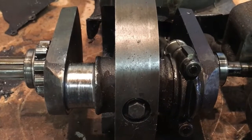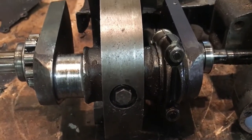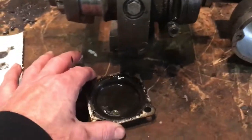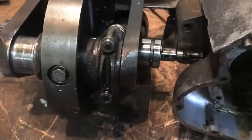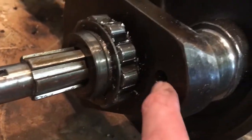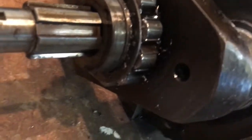What's taken the brunt of the problem is the left-hand big-end journal, rod and piston, and actually that's quite a common feature with these engines. Now, I said we'd come back to the sump plate because of all this disgusting sludge in the bottom. That sludge, when it goes through the oil and the crank, is centrifugally filtered out by a sludge trap that runs through the centre of the journals. On this side here you've got a screw, but on this other side there isn't one — so we'll need to investigate that.